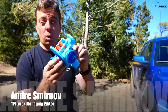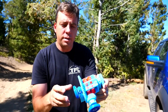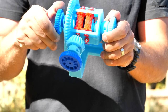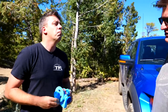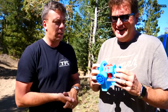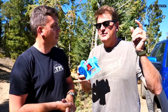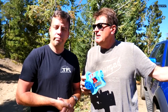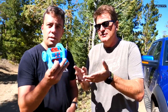I have a model of a Torsen differential here which is 3D printed. Basically it's a mechanical device that allows differential action when you need it, but when there's too much spin it can actually lock both wheels together. That model cost about a hundred dollars and two hours of time. But because we're going up stage three of Goldmine Hill there's a big indent, so one of the wheels is gonna be in the air anyway — we're effectively gonna have only one-wheel drive in the front even with the Torsen diff.